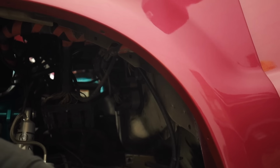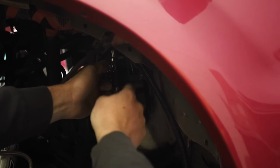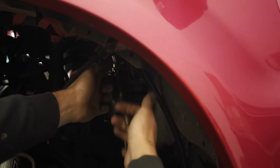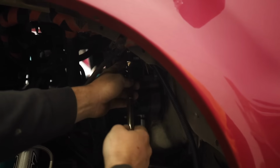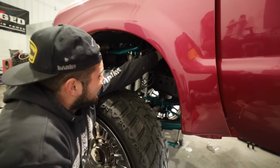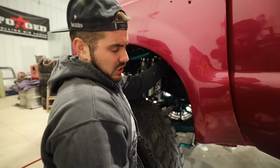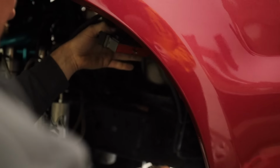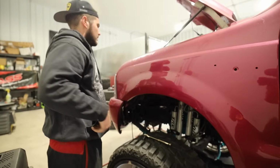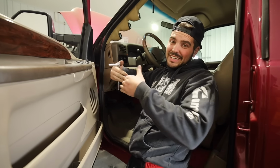It bolts in, but with the liner out, you can reach it right here, which is super easy instead of reaching down underneath the hood, trying to go through all these harnesses behind brake boosters and whatever. Or you can just do this. I already had to do this once when I was taking the DP tuner off, so luckily I know already. When you screw it out fully, this whole connector comes out with that bolt. And then underneath the dash, it's a 7 mil. It's going to take that black case off, and then you'll also be able to slide the computer this way.